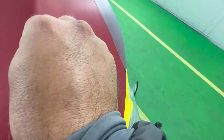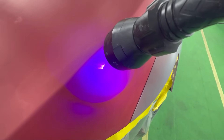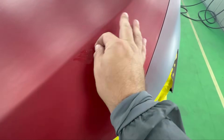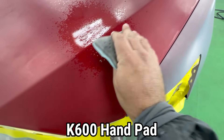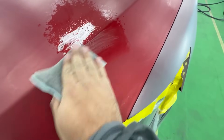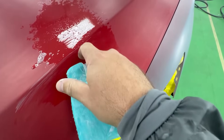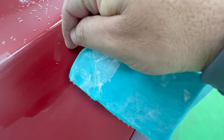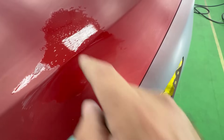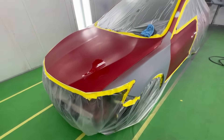It's transparent so it might trick you into thinking it's not filled, but it is completely filled. Then you grab your UV light — we wait one, two, three, four, five seconds — and that is rock solid, ready to sand right now. Throw a little water-based cleaner on it, use my K600 hand pad. This is my go-to pad, and you'll be amazed at how this levels out the chip completely. At this point you cannot catch that chip — it's completely smoothed out. Once it has paint on it you can paint right over that. We'll wipe it off and clean the rest of the car.